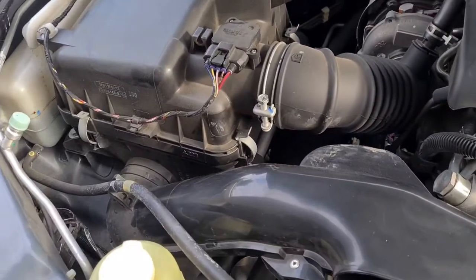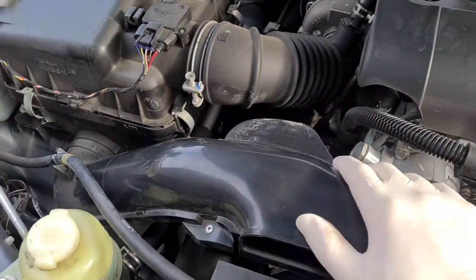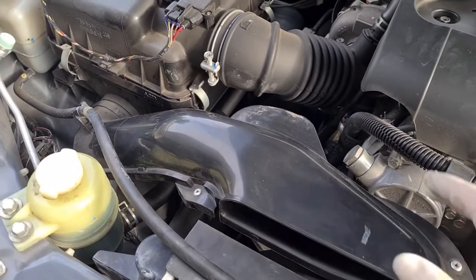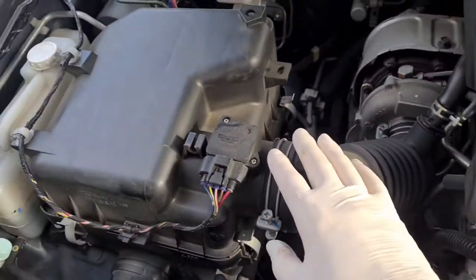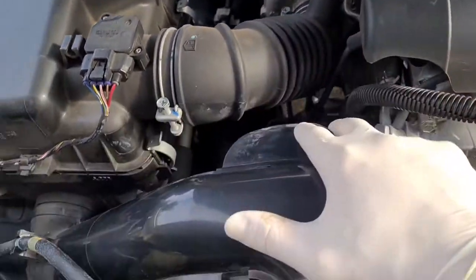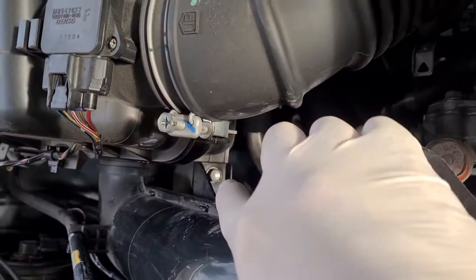All right, so while that drains out underneath, time to get through oil filter now, because we also need to change that when we do an oil change. So the easiest way to do that is just going to make some room for yourself, okay? So we're going to move this cold air intake, this factory cold air intake, and we're also going to move this accordion hose that goes from the air box down into the intake on the turbo. So all you need to do that is a 10mm spanner with a long arm, because there's one down there.